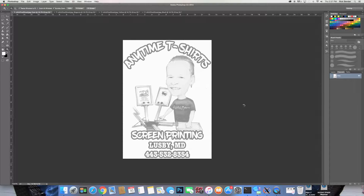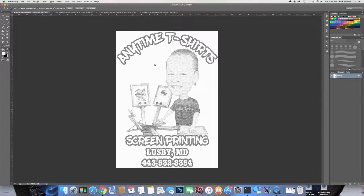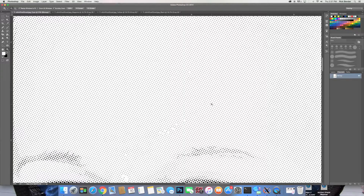It takes a little longer because of the high pixel rate. Now here's your image — let's zoom in. Where did all those funny shapes go? They're not here anymore. See all those dots? Now tell me you need RIP software — you don't. Basically, what I just showed you is exactly what the RIP software is doing: it's outputting at a higher pixel rate than 300, giving you those nice round dots. We just did that by making one adjustment. By changing from 300 to 2880, the printer knows it has to print at that higher resolution, so it's going to output more ink — basically, we've just done what the RIP software does.